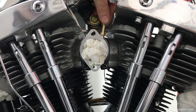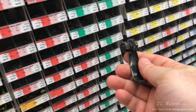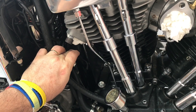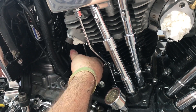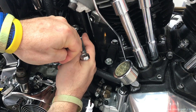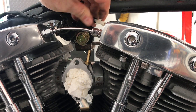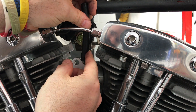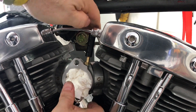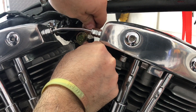I'll put a little paper towel right here too. This needs to be buckled down but a high visibility screw bothered me, so it was on my list to replace — they only had it in grade 8, so grade 8 it is. That'll allow me to secure down these hoses from the previous project. I now have this vacuum fitting adapter and a pre-cut hose from the VOES that makes its way down to this barb fitting, and another piece of hose that I'll now cut. This now connects the VOES directly to the manifold, completing this portion of the project. We can see how it travels up and around directly to the VOES.